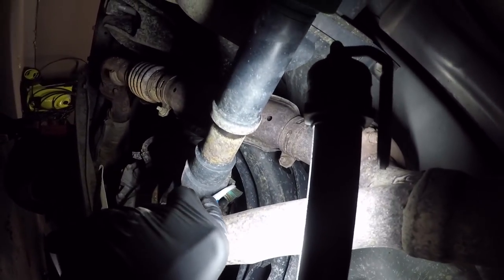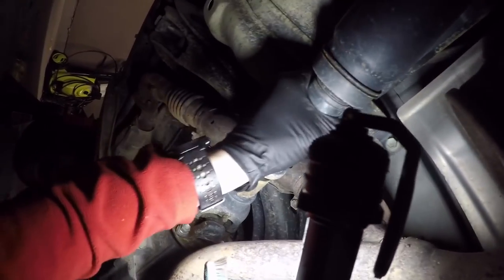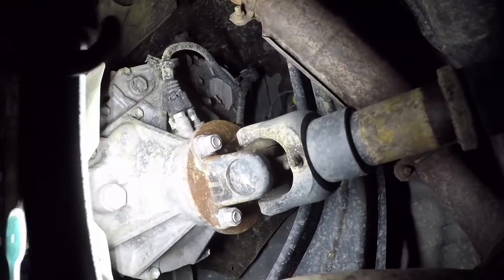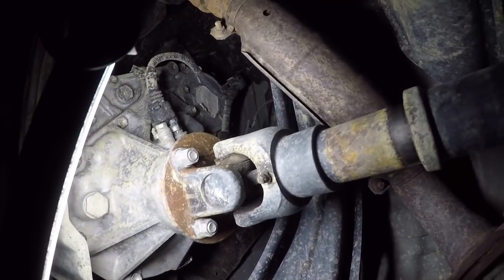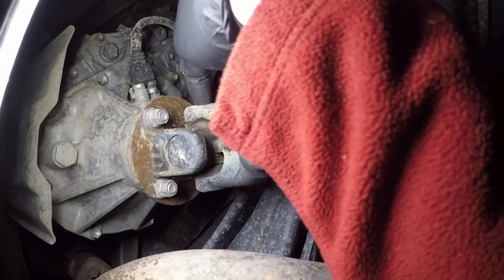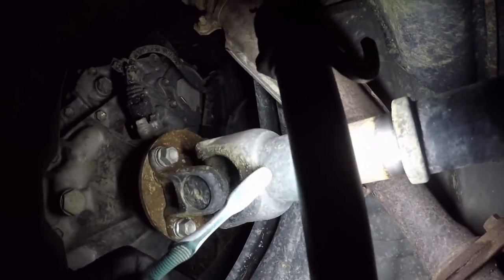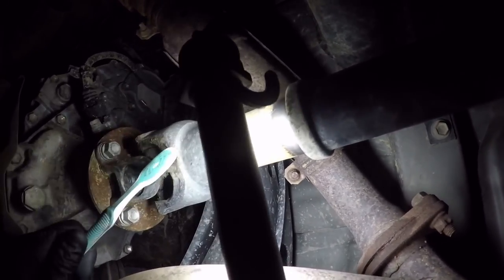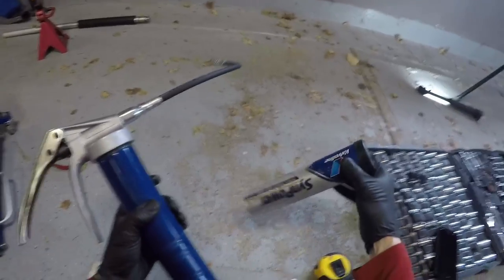Let me show you the fittings we're going to be greasing today. If you look up here you can see that little grease fitting — it's a Zerk fitting and it's kind of in the wrong position, which is why we put the transmission into neutral so we can easily rotate the shaft. There's one fitting here and then one deep in this yoke. There are actually six different places we're applying grease: two on each shaft — a front and a rear drive shaft — one on the yoke on both ends, and then there is this slip joint which moves fore and aft and is greased right here. I'm going to clean these up a little bit with a toothbrush to get the mud and dirt off so we don't cram that in with all the grease.